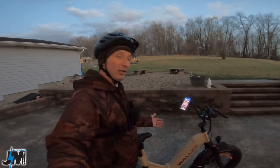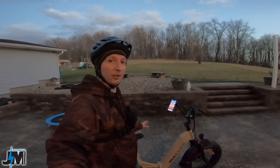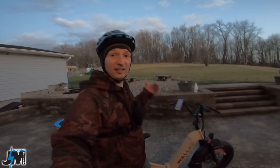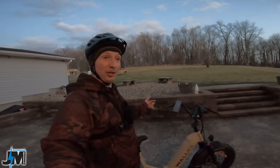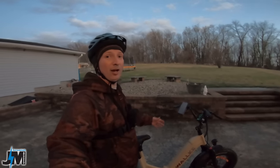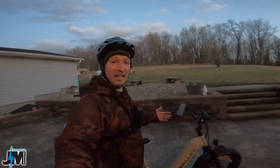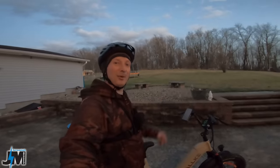I don't know how long it's going to take to cool down, but I'm out of daylight anyway. I don't remember the regular H6 doing that, but I also don't remember putting it through that kind of load — doing max speed runs both ways and then hitting that hill with throttle only, pulling around 1,500 watts almost all the way up. So obviously either something burned out, or the controller is limiting me because it got hot. If that's the case, that is actually a pretty good protection measure.